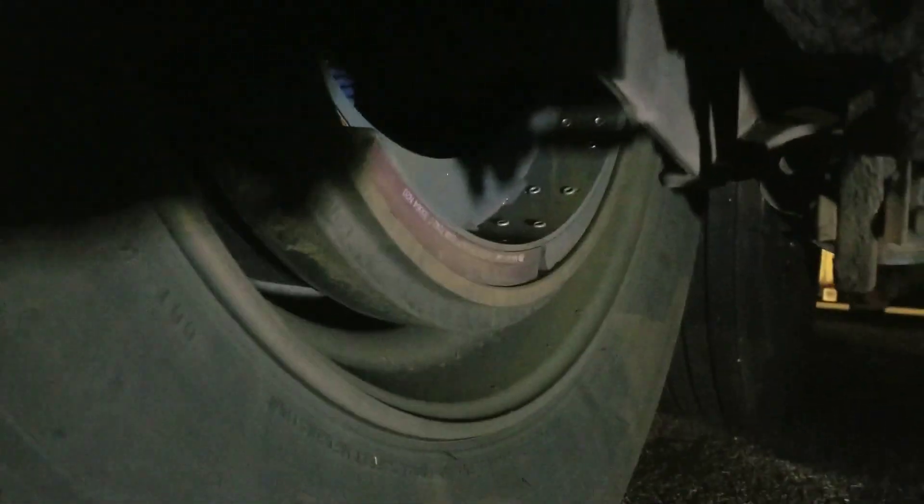When it's like that, check your brakes. You want to make sure there's no visible gap between the brake pad and the brake drum. If there is a gap, you're gonna have to adjust the brakes first. I do have a video already posted about how to make that adjustment — it's pretty easy to fix. If they're adjusted properly, there's a pretty good chance it's not a brake adjustment problem, but a parking brake problem.